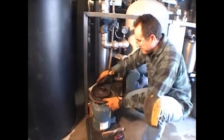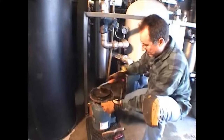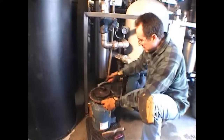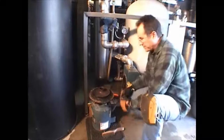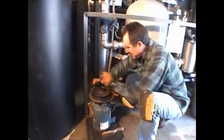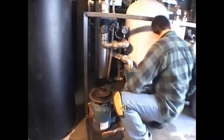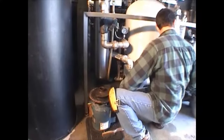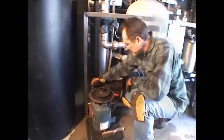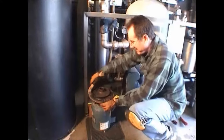The way to achieve a leak-free seal replacement is to make sure all your mating surfaces are clean. I like to use a scraper first to get off all the large pieces of gasket, then go with a razor knife for the pieces that are stuck on well — make sure that blade is level with the mating surface. Then clean it with a wire brush; really take your time and do a good job, and that'll make sure there are no leaks.